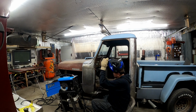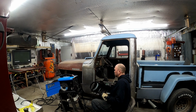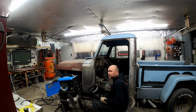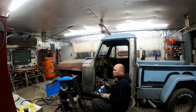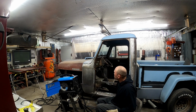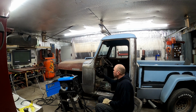Okay, it's welded in good. Not as hot as I originally planned. I got the bottom in nice and hot, and the top, I got about half of it in nice and hot, and then it started welding funny. The backside, I mean, it's good and it's welded. It's just not as hot as I wanted. I wanted to try and get super deep penetration on it, so that I was hitting that plate behind it.